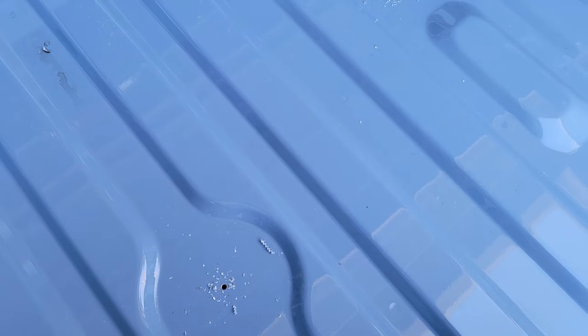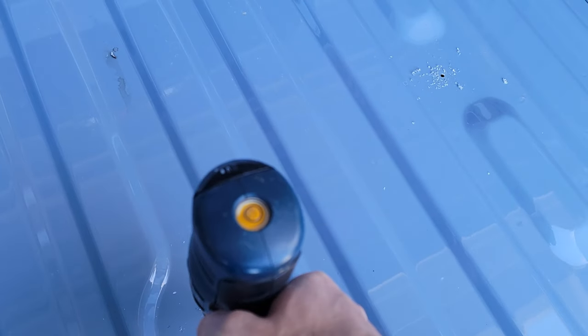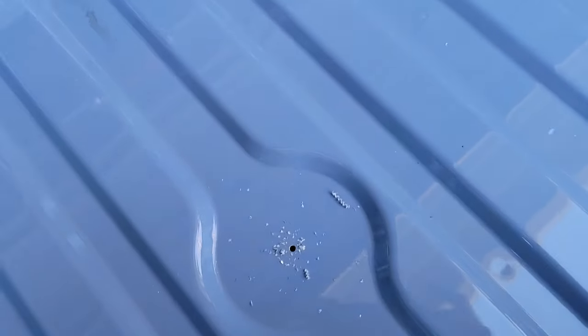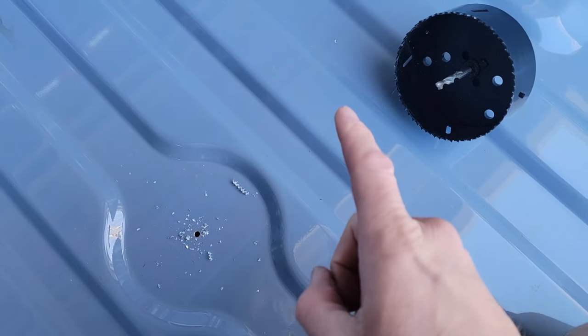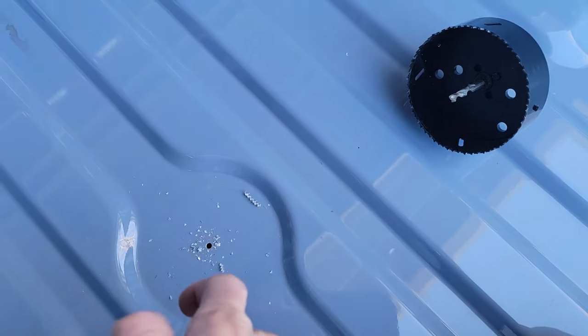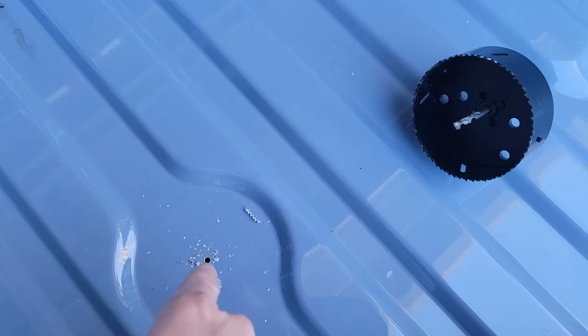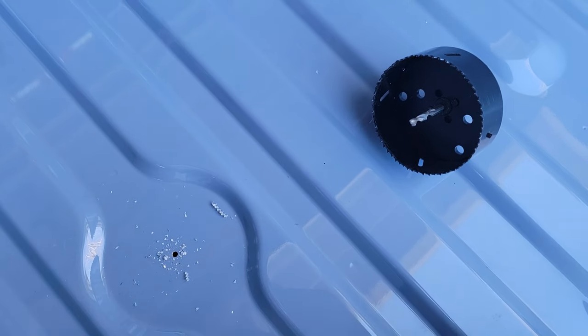When you're drilling, make sure you look underneath your bed first to ensure Ford didn't leave a wire loom sticking underneath. As you drill your pilot holes, use light pressure so when you get done you don't shove the drill bit all the way into something. I've started holes here and here. With the arbor set up for the larger hole saw — it makes a lot of noise — go nice and slow so you keep the drill in control. Once it pops through, the metal piece will fall through, but you don't want to shove it into anything underneath. Make sure your neighbors are okay with it because cutting these holes makes an enormous amount of noise.